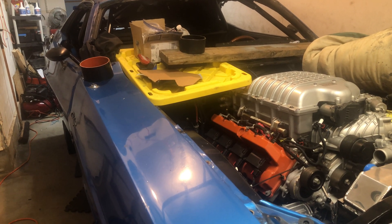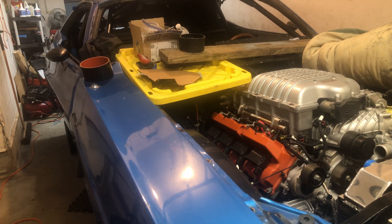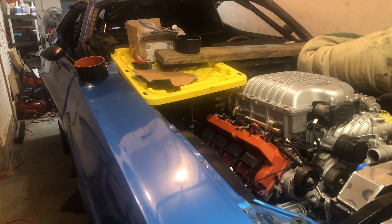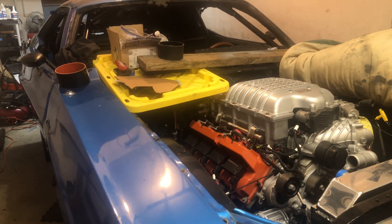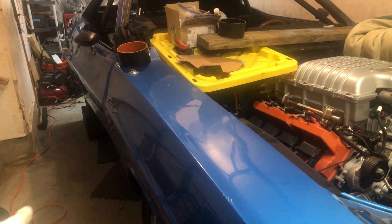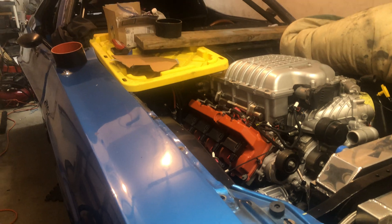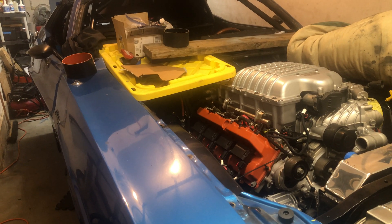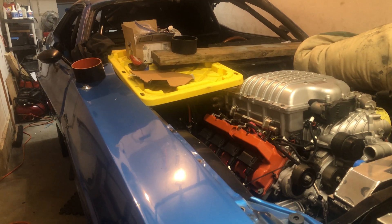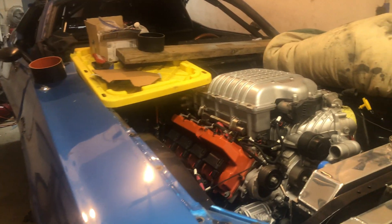One thing I noticed is that all the failures were on longer wheelbase vehicles - trucks, B-bodies, C-bodies. On my Z-body it's a very short wheelbase, so it shouldn't be hard to get a driveshaft with a substantial critical speed that won't run into issues. I have a 3.23 gear out back, and I'm planning to run a 28-inch tire on the street and maybe a 30-inch drag tire on the track, which will reduce driveshaft RPM.